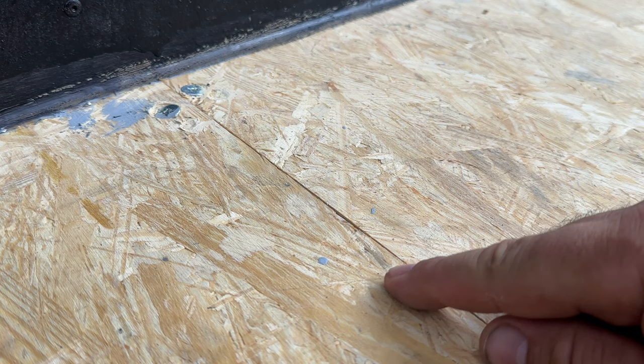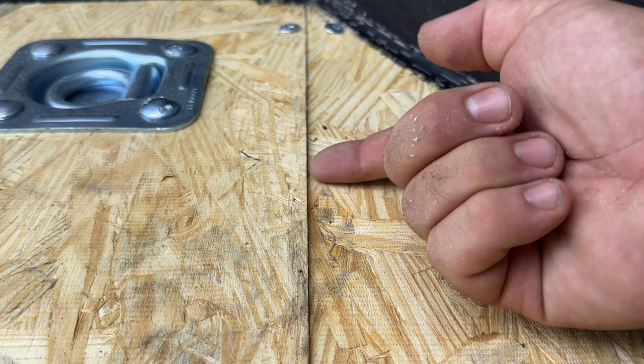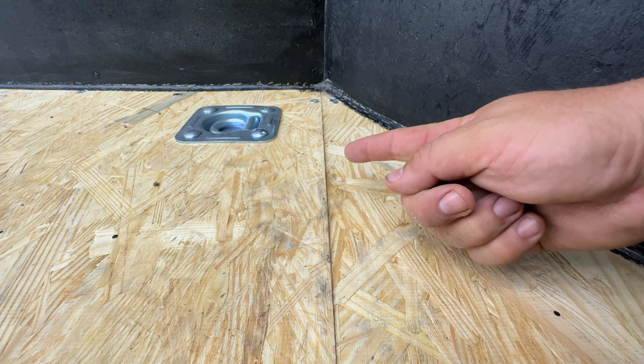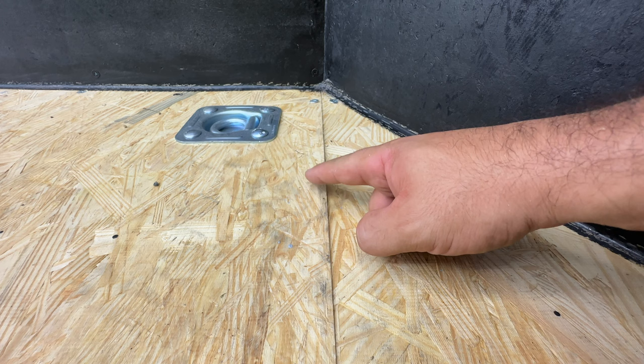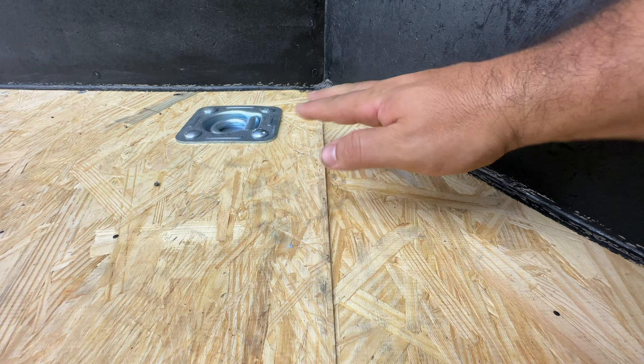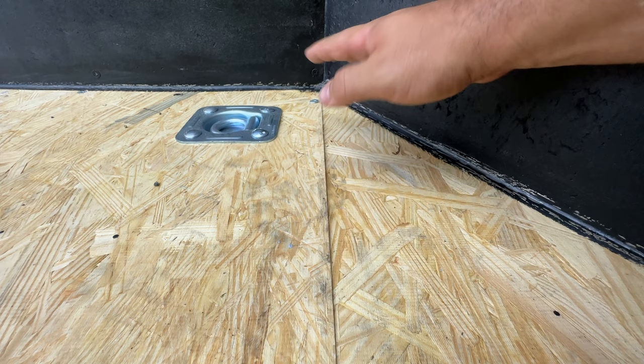After screws, we want to check all our seams where two pieces of wood come together. Even on very good ones, we want to take a sander to it just to make sure. This area, however, is not good — there's at least an eighth of an inch drop in this corner at the front of the trailer. I tried jumping on the wood to see if it was bowed up so I could sink some screws in to drive it down, but it's not moving. So regardless of the reason, I'm going to smear some Bondo on here, completely level it, and then sand it down for a much more permanent flat result.